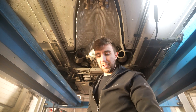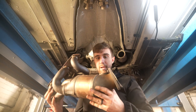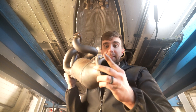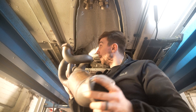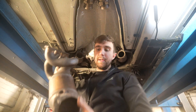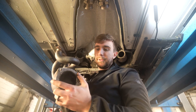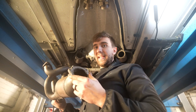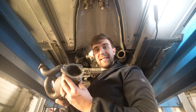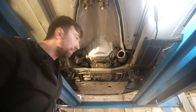This is potentially the trickiest stage of the install. I've got a cat here just to show you — this is your primary cat attached to your manifold. These bolts are pressed in, so you need to press them out. You don't need to press the top ones out, but you do need to press any on the bottom as they're offset on each one. You could use a vice or a clamp to put a bit of pressure on and push them out. Do be careful — if you start smacking these with a hammer there's a good chance you'll shatter your cat, and that's an expensive replacement.